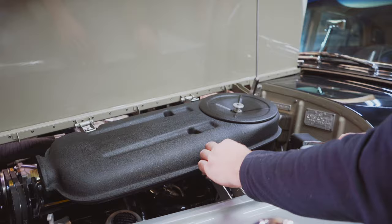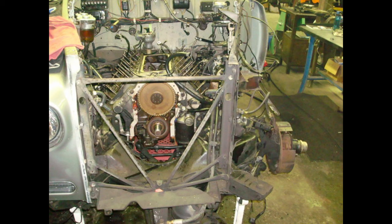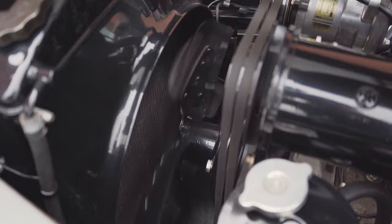After we finished the restoration, we used waterless engine coolant, and that allows us to open and inspect the coolant even when it's hot, because there's no water or water vapor pressure. We removed the radiator and used a high-efficiency V-cell radiator core, which we were able to get from a contractor in Pennsylvania.